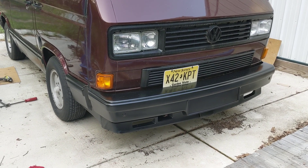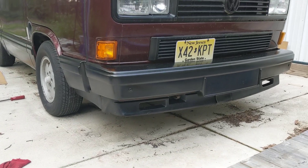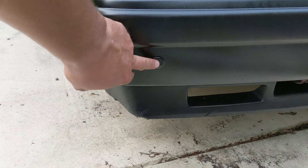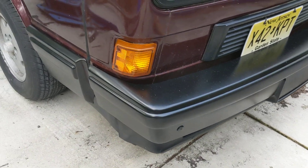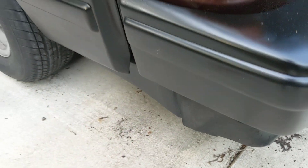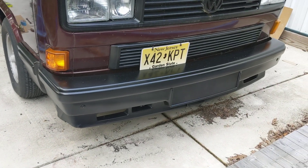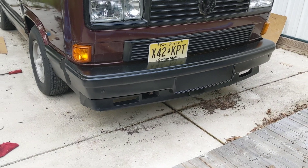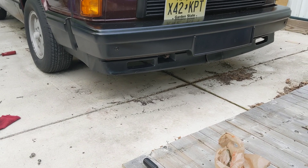When last we spoke, we were putting the bumpers and things back on. You can see I got the front bumper on. I actually took these hardware bolts off, bead blasted them, and painted them with the same paint we painted the bumper with. Also, when I told you guys about taking these off, there are actually a couple of 10mm bolts under there that you have to remove, and you also have to remove some of the spoiler pieces. The stuff turned out pretty nice — we painted our bumper and painted our spoilers under here.